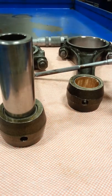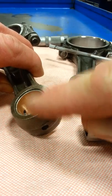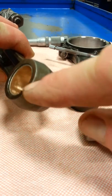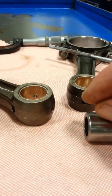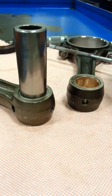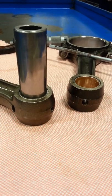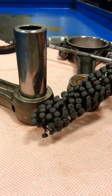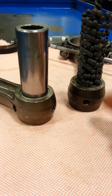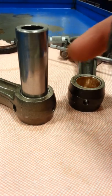I'll refer to manufacturer's spec. This is the rough hone finish, and prior to putting it into the engine, I can go back in with a small ball hone and do a finish fit - a finish hone - so that I have a nice surface for oil to ride on and reduce friction. You can see there's a nice crosshatch in there. Here's the example of the ball hone I'm going to use to do the finish once I've established the exact clearance. This will be run off of a drill arbor with lubrication, and that'll provide a nice crosshatch and the right fit based on manufacturer's specification.